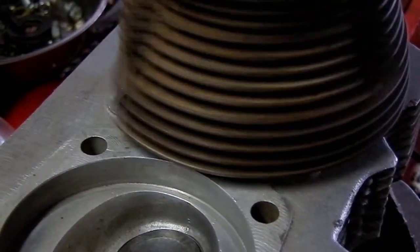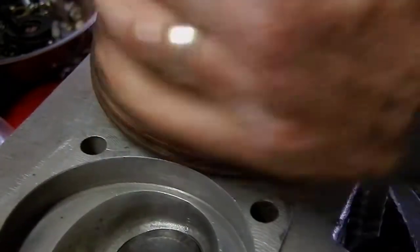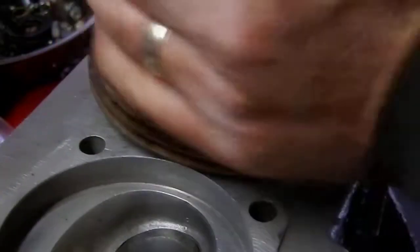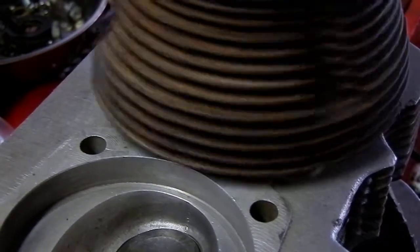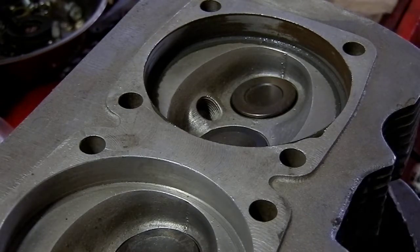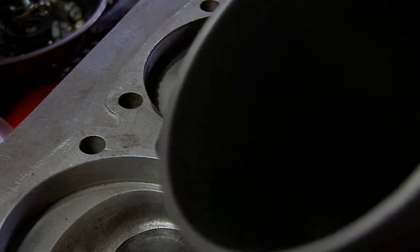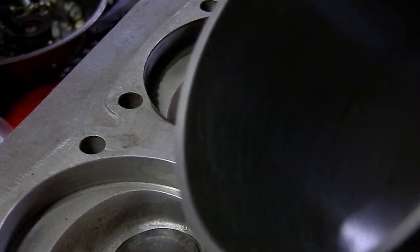As long as you're pushing down, you can hear the tones changing — it doesn't sound as scratchy or rough, and it feels better under hand. Once it's changed enough and is consistent, you can take it off and check the top of the cylinder. There it is — nice and smooth and flat and mated.